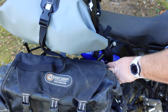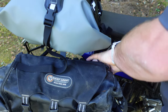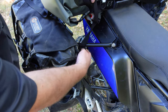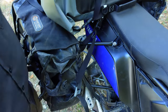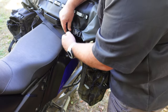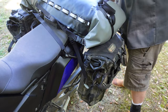Now let's attach the front — I'm actually going to go to my pannier racks. That'll pull this back just a little bit farther, kind of behind the around-the-world panniers, and I'm going to make sure it's in front of the crossbar so I can use it to tension the straps down and put the bag right where I want it. I'm around this and behind this so that when I pull them together and tighten it down, the straps will pull against each other and it's going to be very secure. You've got to get a little creative — every bike is different, every rack setup is different — but for the most part there's always a way to get these girth hitched around something.